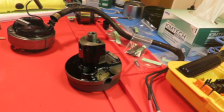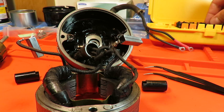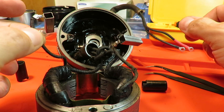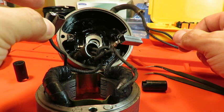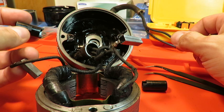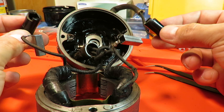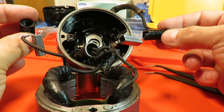All right, so we're gonna get the field core and the motor housing back together, and to do that we need to re-establish the connection with the carbon brush boxes, these silvery metal, typically brass holders that hold the carbon brush and spring against the commutator. These are contained within Bakelite sheets on either side, and removal of all of this is really impossible without separating the metal box from the Bakelite sheath, which after 100 years of sitting together, they were reluctant to part, but some penetrating oil helped with that.